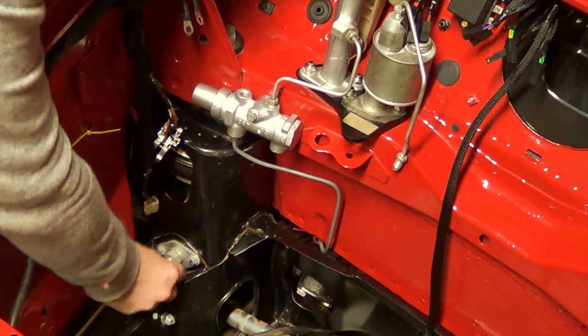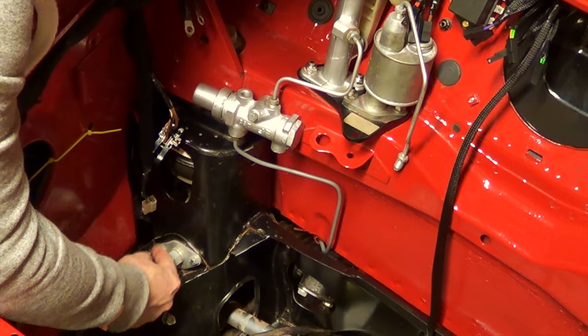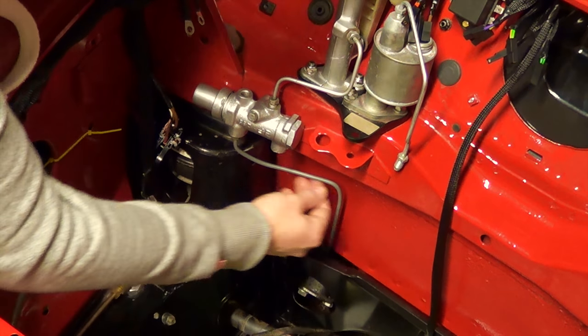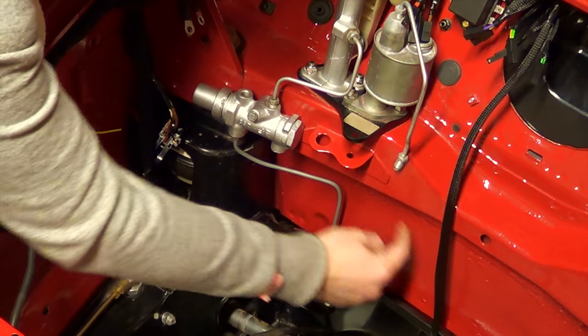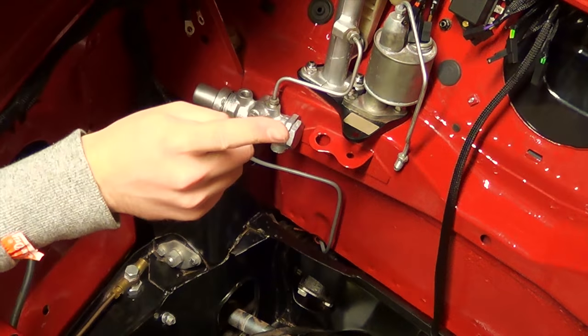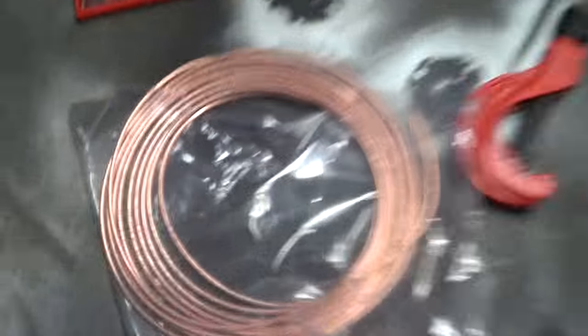What we're going to do is make a piece of brake line that goes from this union here, and we're going to bend it so it goes into here. I have got these the wrong way around, I need to undo that. When I push it there that may be a bit long, but we'll try and lose the slack somehow. We need to make a short piece, and then we've got the piece that needs to go to there — I'm going to respray that.